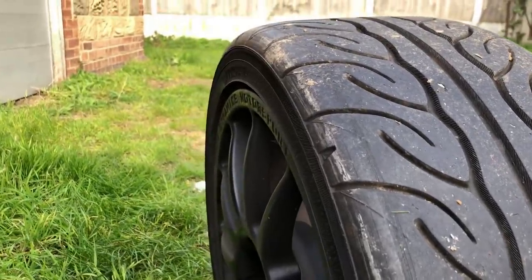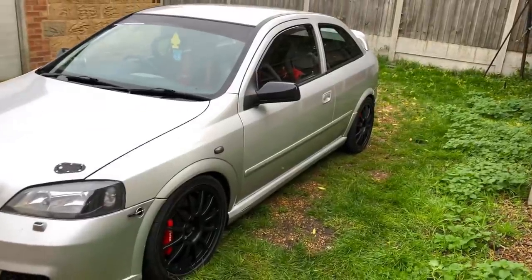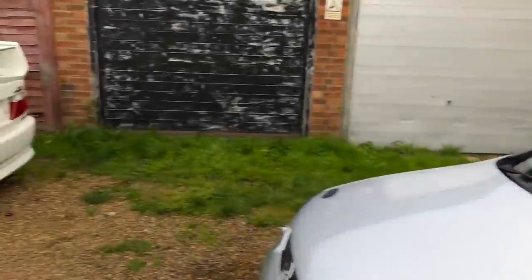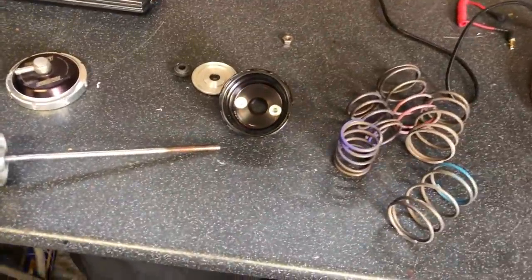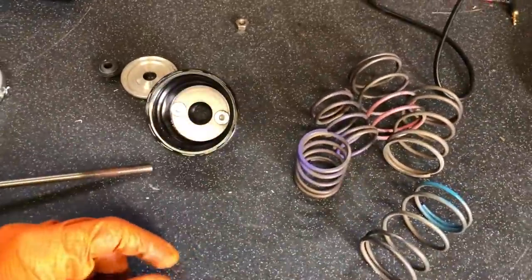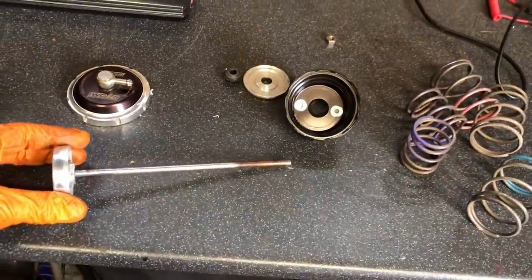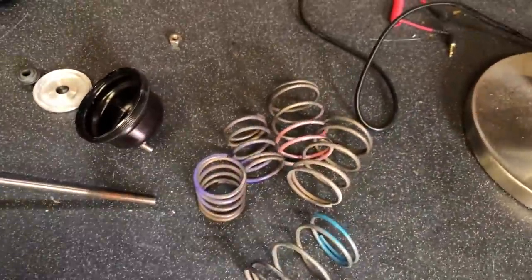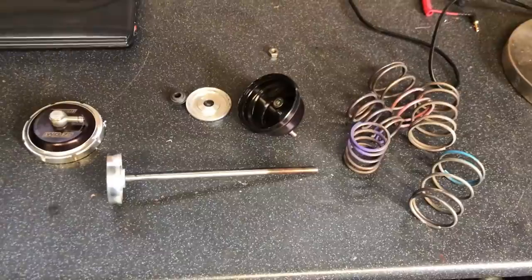The car's had a fresh wash — it's clean although it'll get filthy again quickly. As we've upped the boost quite a lot, the actuator spring inside the Turbosmart wastegate is not strong enough to hold boost up top. I've got a bunch of springs to mess around with. I've disassembled the actuator — it's a very simple design — and I'm going to try different wastegate springs until I get the desired boost pressure that holds up to around 7000 RPM, which the new turbo can do easily.